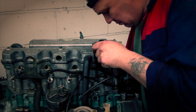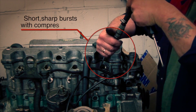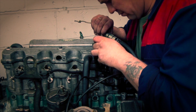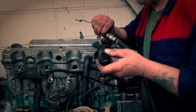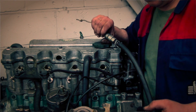Some of you won't have an air compressor available, but if you do, here's a little trick we use to loosen off the washers — and this works 95% of the time. Just blow the air down the cylinder with an extended pipe and let it release, then you can pick it out. If not, use a hook tool to fish it out.